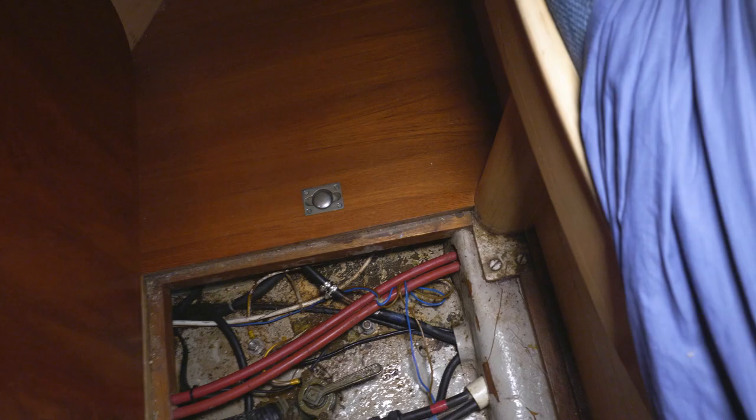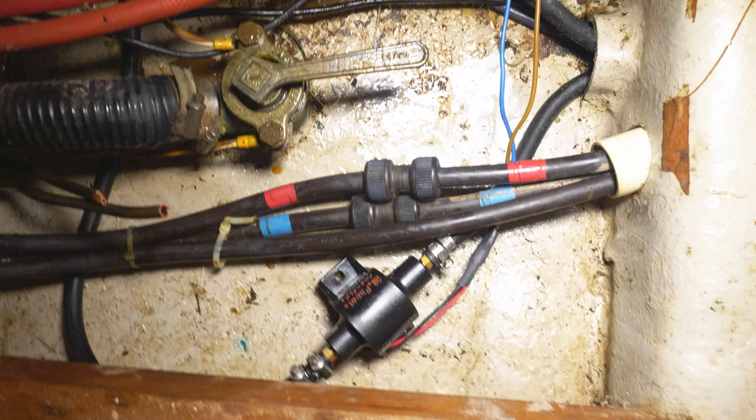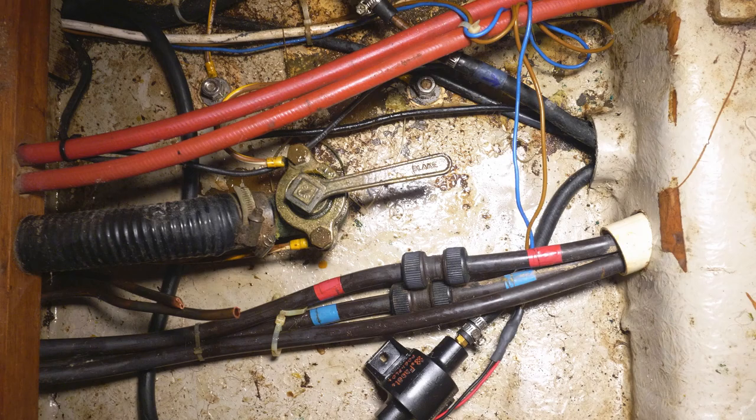I've now got cable ties on all of these — they run underneath there and through there. It's really important to cable tie them up so they're nice and tight. I've rearranged this area slightly to make it a little bit clearer. There's our fuel pump, and there is the return just underneath that red cable. Again I've kept a tiny little bit of copper pipe left just to connect the two, and I'll zip tie those so they are nice and secure. Now I need to make sure the leak is no longer leaking.